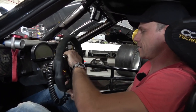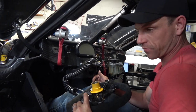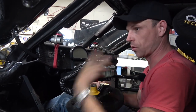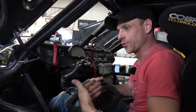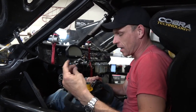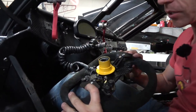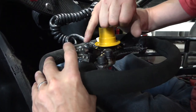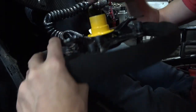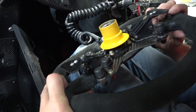Oh — the steering wheel. Yeah, that comes off. Actually, that's kind of cool. There's a seat belt on my butt — I don't remember it being like that. Anyway, I'm going to stick this back on. Here's the quick release of the steering wheel. This car does in fact have paddle shifters. I dog on paddle shifters for street cars because Ferrari and Lamborghini totally sold out by getting rid of stick shifts so they could sell to more rich people who can't drive. But in a race car, it's actually helpful to go faster because you're not going to mess up, and it can shift faster with the dog box. The actuation is very simple — a nice billet aluminum piece with a tiny little carbon fiber tab. It has a rare earth element magnet so there are no springs — when you release, the magnet just sucks it right back together. There's a tiny micro switch that tells the computer to actuate the pneumatic ram to shift into gear, as well as initiate the computer protocol so you can shift with your foot flat to the floor.